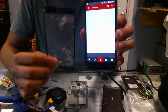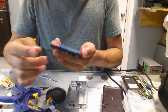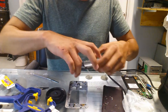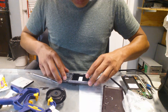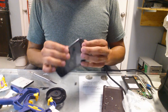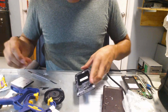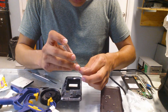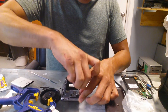It's no longer a cracked digitizer — it's brand new. And that's it, you're done, you're ready to go. All we need to do is put it back together. The way you took it apart, put the back in place, press all the corners and all the sides, make sure everything sits in place, and then put the screws back in place. And you're good to go.